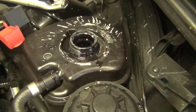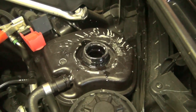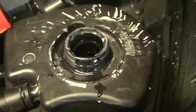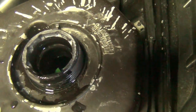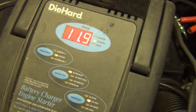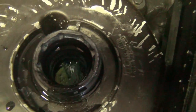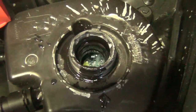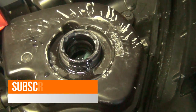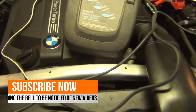The pump is running and it's actually pushing the air out — as it pushes the air out, refill it with coolant. This can't be done on something like an N62 — it requires the electric coolant pump. The normal bleed procedure takes about 12 minutes and you just have to keep an eye on the coolant level. Keep your charger on — the battery voltage dropped to 11.9, so it is a good idea to have a charger on. Run this again, make sure your battery voltage is good. Once this is all done, put your cap on and you're done.